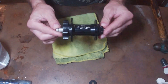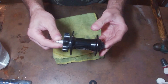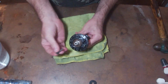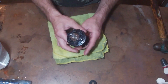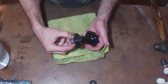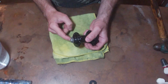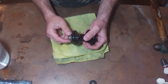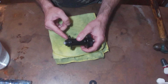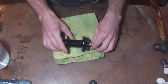Now we're left with this hub. You have a couple of options. You could grab a steel bolt that will fit into that hole, put it in there, and then knock that out with a hammer. What that will do is take out the axle hole, take the end cap off, and potentially the bearing on this side as well. So if you're just trying to get the end cap off on its own, that's probably not the best option. It is an easy way, but you end up with the end cap and the bearing stuck to the axle - though you can actually just punch that out anyway.